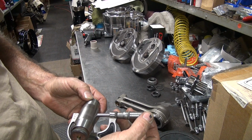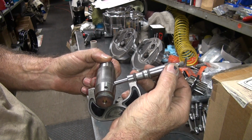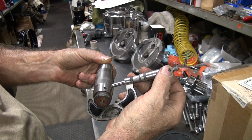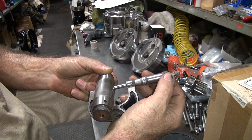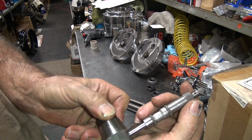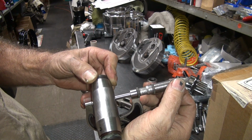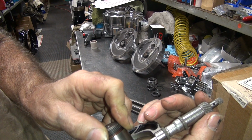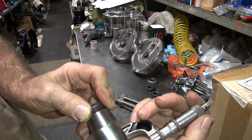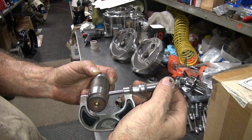Okay, so this one here is about 1 thou under on that, 1 under. Okay, so there's a couple tenths there, which for them that's pretty good quality, but yeah, it's a little bit more than a couple tenths there. Let's see, that is 7 or 8 tenths under. It's kind of in the middle. You rotate it around and it's 8 tenths. 9 there.